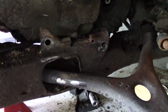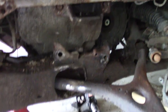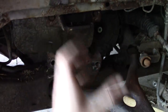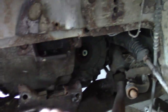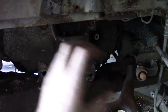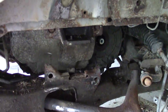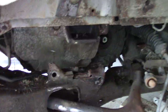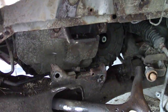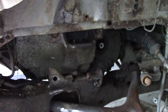When these things break, a couple of things happen. If you have a car with a column shifter — I've preached about how much I hate column shifters — this is exactly why they break. When the motor mount comes loose and breaks open, the engine shifts just a little bit. That column shifter cable is mounted to this unibody frame on one side and to the transmission on the other. When the transmission rocks, there's no give in that cable, it stretches it out, the housing around the cable blows apart, and the cable blows out of that housing so it can no longer fully push the shifter lever.